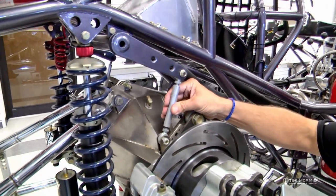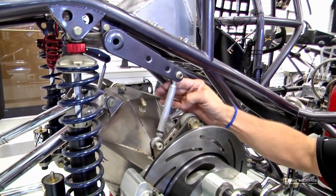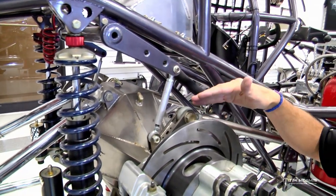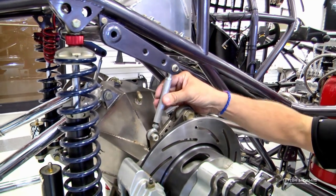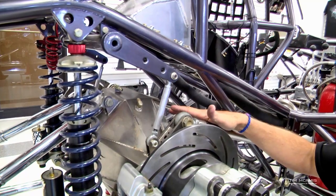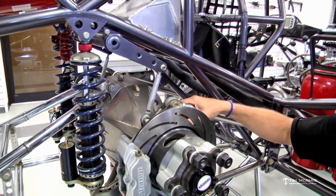The preload is going to twist the housing a bit and load it to get the car to go straight, and then the sway bar can be neutral with no load on it — then you jam it down. A lot of guys get up under the back of the car when it's down on its tires and try to neutral the sway bar with it sitting on the wheels, which is fine too, but it's really hard to reach and hard to get to the jam nuts.